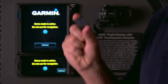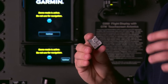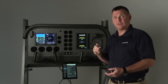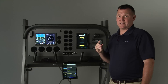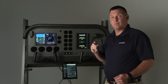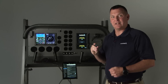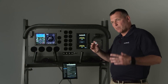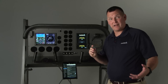This little card can save significant time in the cockpit by pulling together and concentrating numerous different sources of information coming from your certified avionics. For example, GPS from your GTN, XM weather and music from your GDL69A, ADS-B traffic and weather from the GTX 345 or GDL88, Iridium satellite calls or text messages through the GSR56, and AHRS information from the G500 or G600 — all pulled together and shared wirelessly via Bluetooth with two iPads running Garmin Pilot or ForeFlight.